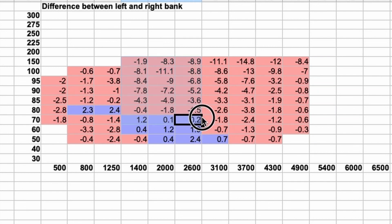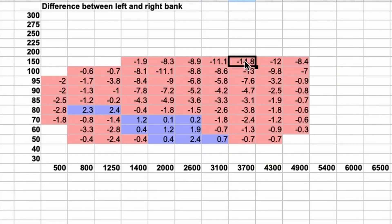I went ahead and put some numbers and calculations into the spreadsheet. This is not a fueling map per se — this is purely the difference between the banks of cylinders, between driver's bank and passenger's bank. This is how much fueling difference there is, and it's unbelievable. We're talking 15% at 3700 RPM, 12%, 10%, 11% — it's all really high. So we have a huge discrepancy between our banks of cylinders.